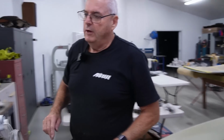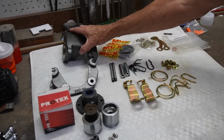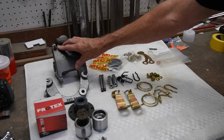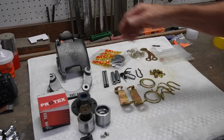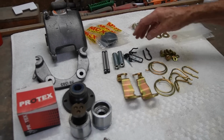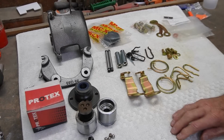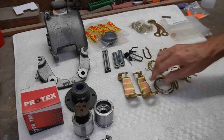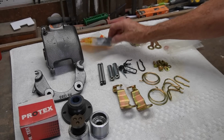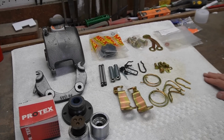The last thing is the rear brakes. You've seen I had some rusty old ones on there. This is the brakes off the car, so these are being all cleaned up and painted with some VHT heat-proof paint in a cast iron appearance. And then I've been fortunate enough, and I've had some of this stuff for a long time now, to get a rebuild kit. We've got new pistons, and then I sent all of the original parts away and had them re-zinc plated. So when it goes back together, they'll look pretty much new, or better than new. And I've got all new seals and all to go on the piston. So that's a job for Howard to do.